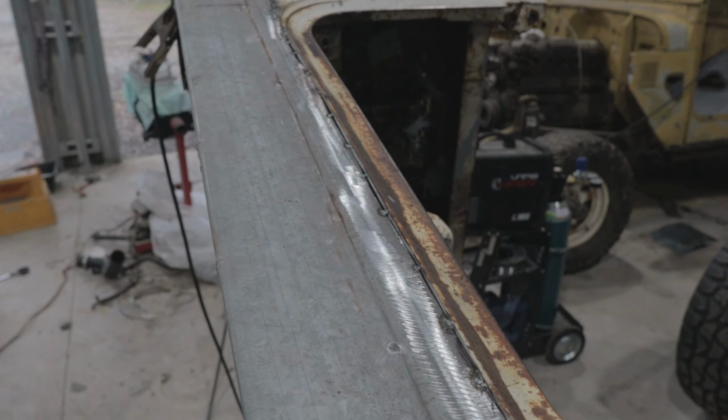What we just did there, we got this outer sill in. This is just a bit of RHS that I cut up and I had to weld it up at the top and down here. And so now it will actually sit flush up. This new rust cut will actually sit nice and flush up against it. And so that'll be the right spacing this way.